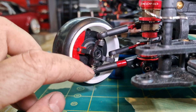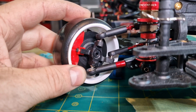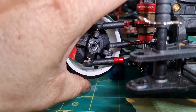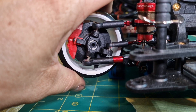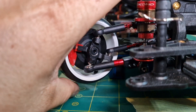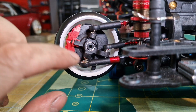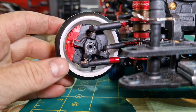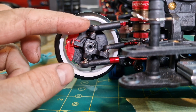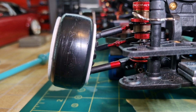I'm also going to try and space out the hub mounting points as well as the top arm to try and give us the clearance so this can come right the way over to full droop or compressed. In extreme conditions while driving you do want the car to go to full droop and have a consistent amount of lock. You want the upper and lower arm to be parallel with themselves, otherwise you can get bump steer. The amount you raise the hub and the wheel needs to be the same amount that you raise the top arm.